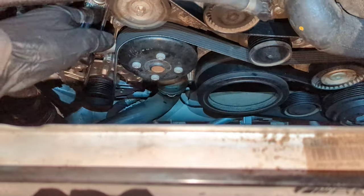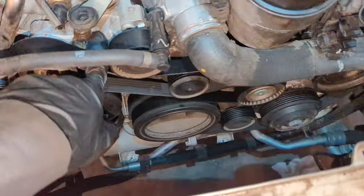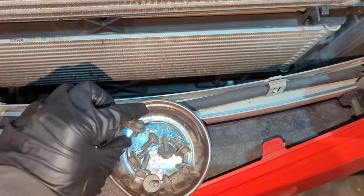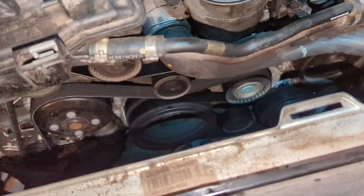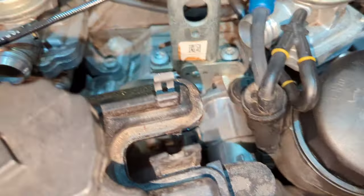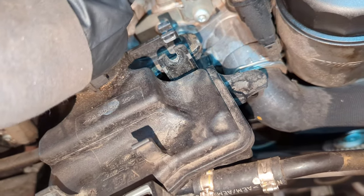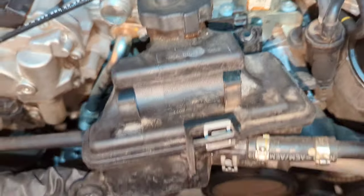I've got the brand new belt installed. Make sure it's all lined up and grabbing all the ribs on all the pulleys. What really helped was removing this power steering reservoir — it's just held down by this bolt right here. That really helped with visibility up on the smaller top pulleys. All you have to do is bring it forward, and you can see that little gap that goes right around the engine lift point. It's just held down by one bolt through this little hole, and it just pops right out. Then you just have to undo this evap hose and it slides out.